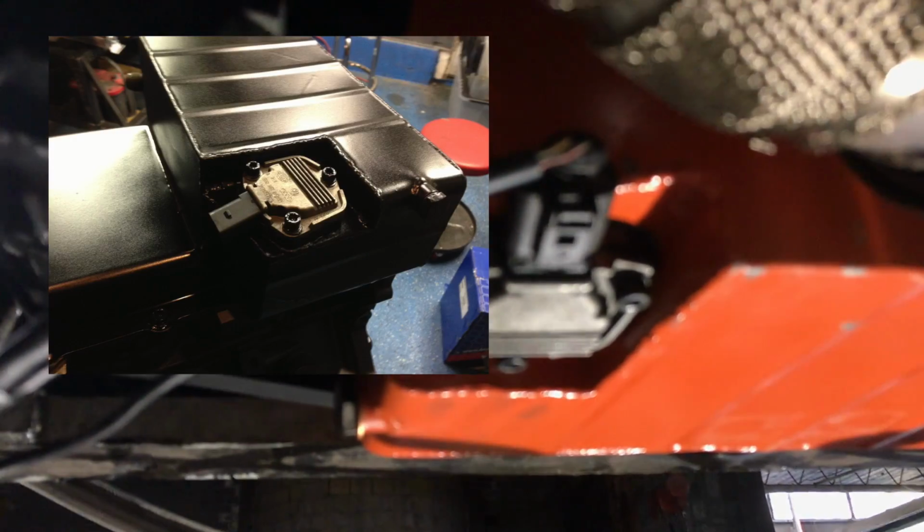I modified the Canton oil pan. This is when I mentioned earlier the two sets of sensors. That sensor there I cut and let in is the Audi OEM oil level and temperature sensor. So that's feeding the Audi ECU, which can then report on the Audi dashboard oil level and temperature warnings. And this is the AC pump, which I'm going to delete at some point and replace with a mechanical vacuum pump.